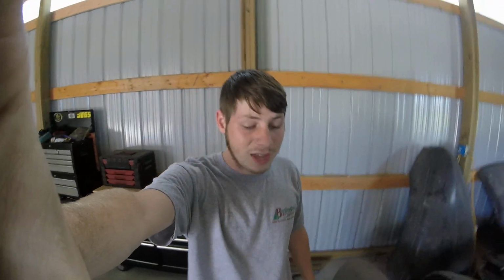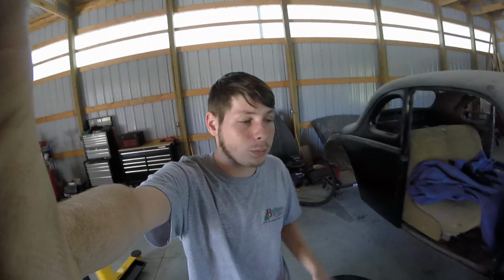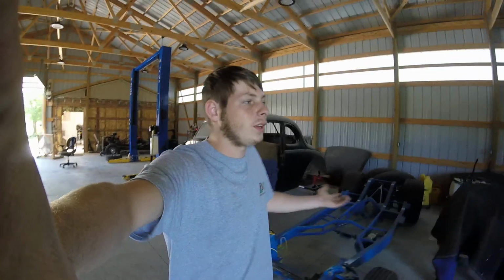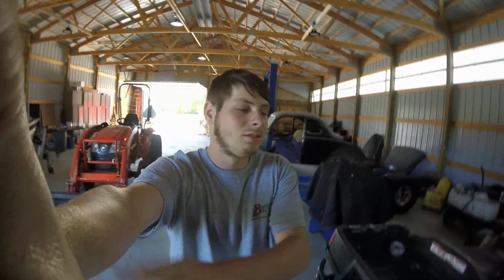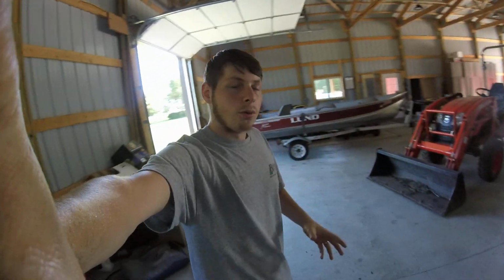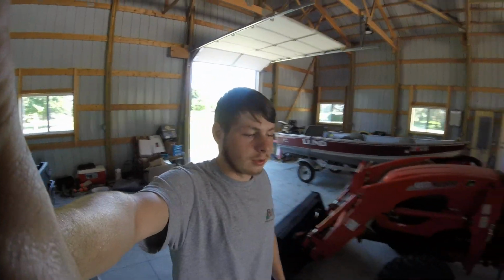I can't think of anything that would make that knock other than a spark knock, because I just put this big bore kit in it. So I'm worried that I put something together wrong, but there's nothing to put together wrong. You have the timing chain, and I didn't touch anything on the head, so there's nothing wrong with that. I literally took the head off, put the new cylinder on, put the new piston on, and ran it. And I can't get it running right.